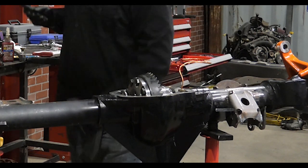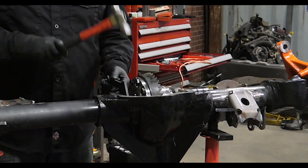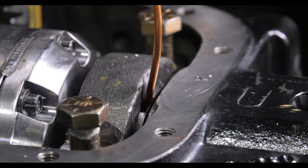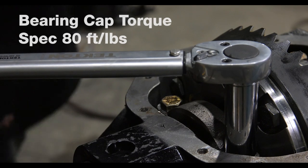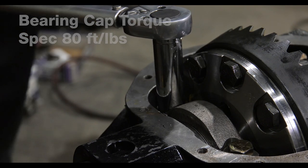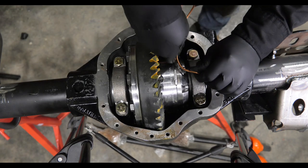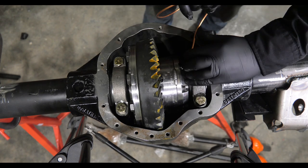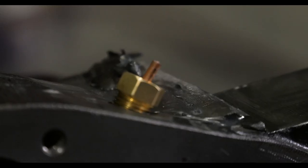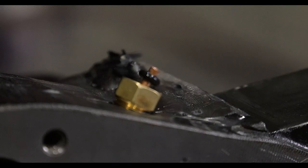The large shim will need to be driven into place — this is where that shim driver comes in incredibly handy. Double check the clearance for your air locker copper line and torque the bearing caps down. We'll then carefully route our copper airline for the final routing, making sure it's nowhere near the differential or the ring gear so it won't contact them while spinning. Then we'll trim it to length, slide it through the bulkhead fitting, drop on the o-ring, and install the push lock connector.